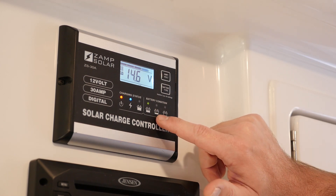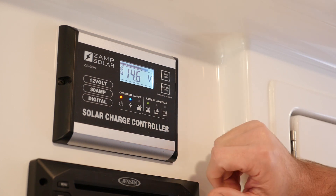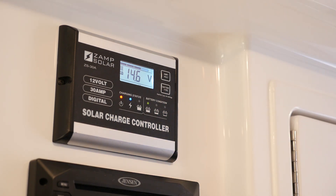If you ever see the low battery light, it means your true battery voltage is about 11.5 to 12.5 volts — you'll want to start getting some charge into the batteries. If it falls below 11.5 volts, it'll kick to the next warning light. At that point, some 12-volt systems on board will act funny, some will stop working altogether, and your lights will start to dim as voltage continues to drop.